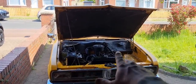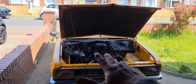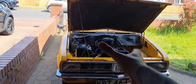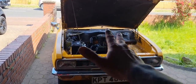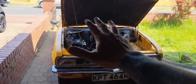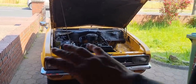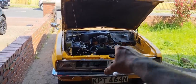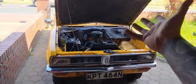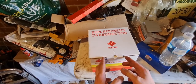Timing set, clutch cable all sweet. I just went for a little rip there, and on the Zenith carb — I know it hasn't been rebuilt for at least 10 years — it's performing pretty well. Apart from the idle jet being a bit iffy when she's warming up, it's pulling much better than the Stromberg. But the rebuild kits for these Zeniths are over 50 quid, so I thought let's go for a Weber.